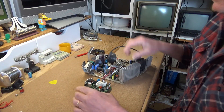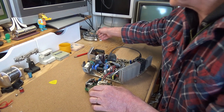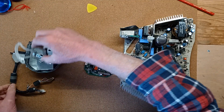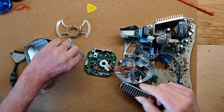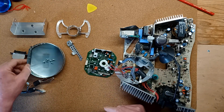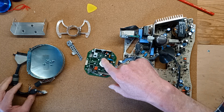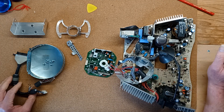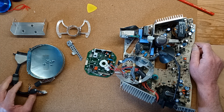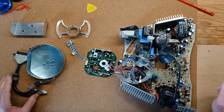And we're back, and the neck board is recapped. So I need to put the neck board back together, which is this collection of odd-shaped bits and pieces. I need to connect up some cables with the neck board and then put the machine back together, and at that point it will be time to switch on. So let's get started with that.